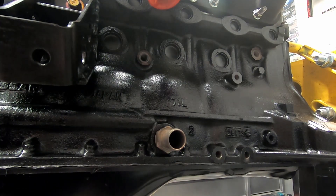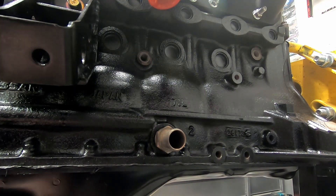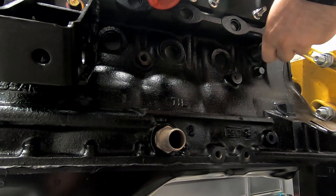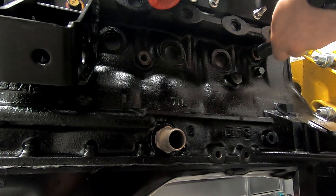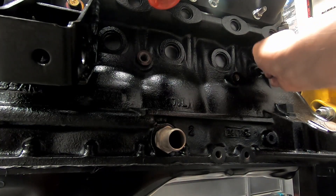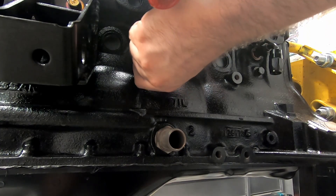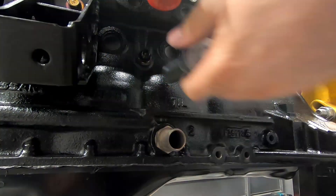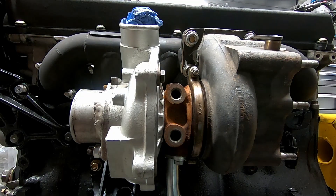It's time to make up our lines for the turbo — coolant and oil lines. We'll first attach our fittings into the block. For now we'll just do these to 10 Nm, though we might go a bit tighter, maybe to 15. We'll hang the fitting on for now. Obviously we need to make our own lines. So we've got our block oil fitting done, and now we can do our coolant lines.